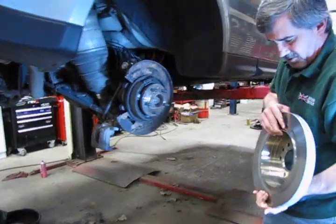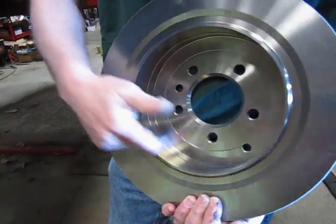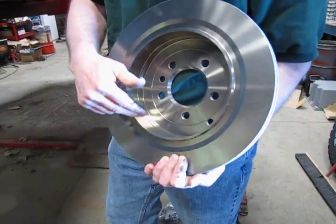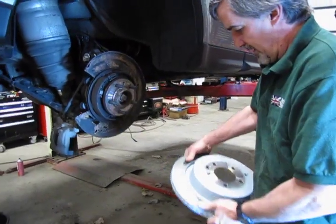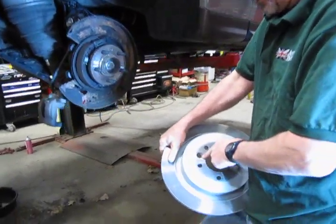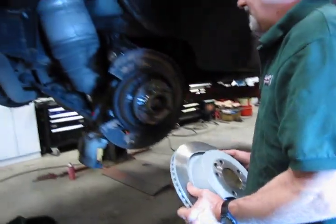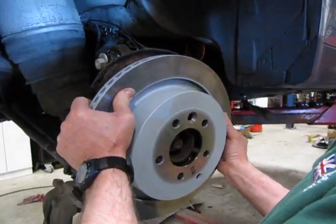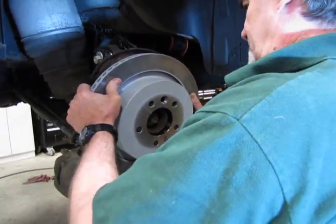Now you can identify the rotors compared to the front, because in the rear it actually has a brake drum machining on the inside of it, whereas the front rotors do not. Make sure you line up your lockdown hole, tapered hole between the lug nut holes. Now the parking brakes may not be exactly in position when you go to sit these on. So sometimes you gotta tap them and fool around with them a little bit.